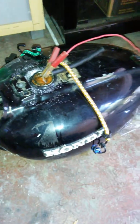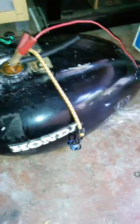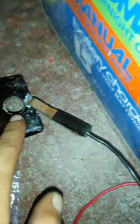Hello, as you can see I'm doing electrolysis. This is a CM 400 gas tank from an '82 Honda. What you need to do is get one of these, put the negative on anywhere along the tank — everybody says on the backside right here. I even scratched off some paint to make sure I had good contact, then you put the positive up here. I use a strap.